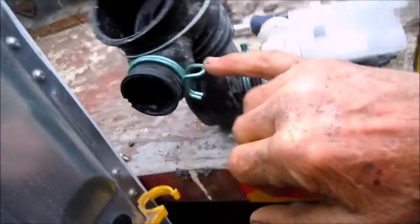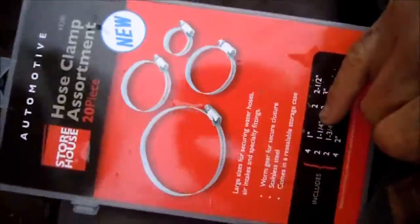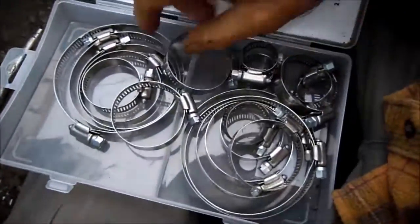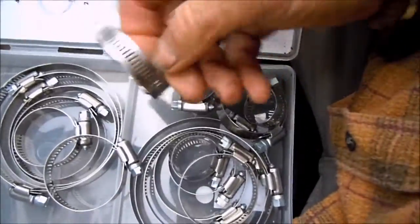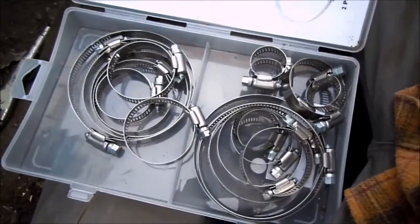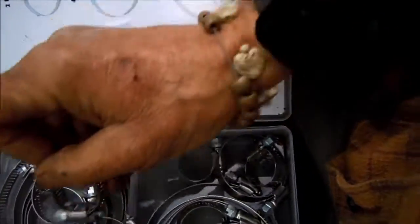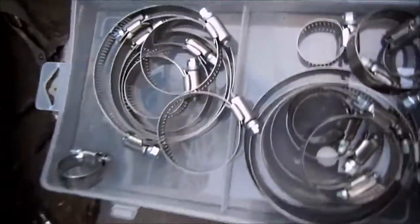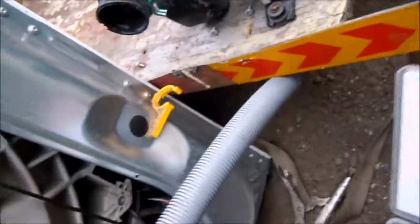When you're putting this back together, I usually assemble this part here first. I take the clamp off and put on screw-on clamps. You've got to be careful with the cheap Harbor Freight clamps because they're basically one-time use. These larger, heavier-duty ones are better — hopefully they won't come apart when tightening. The really small assortment Harbor Freight has will tighten up once and then you can't get them undone. So for a water pump job, it's a good idea to have some nice hose clamps so you don't have to try and reach under there and squeeze those clamps.